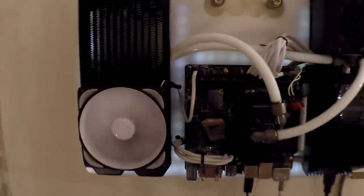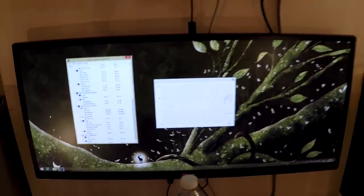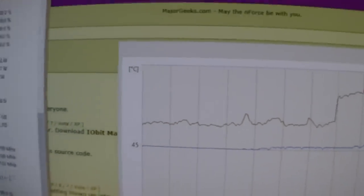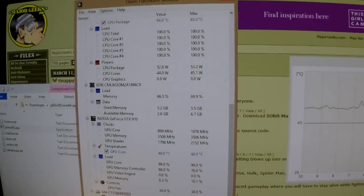I've got the system fired up. I've only got one fan at the moment — still waiting for the other one to arrive. I'm not going to be doing any overclocking and I'm running the fan at full speed at the moment. Water level has dropped a tiny bit but it seems okay. Using Open Hardware Monitor, the GPU is at about 27 degrees and the CPU is hovering just under 40. I've had Furmark running and I've just started Prime95 blend — the CPU is at 63 degrees and the GPU is at 47. Remember that's Furmark and Prime95 running at the same time — that's pretty good.